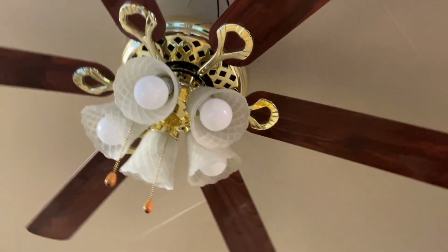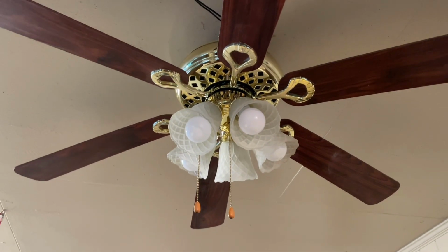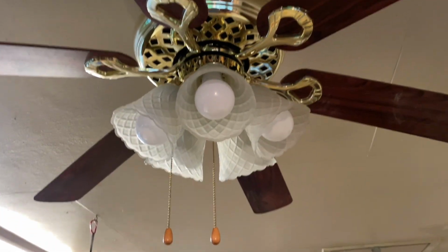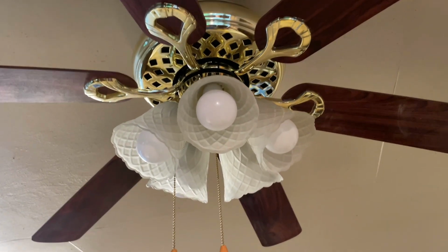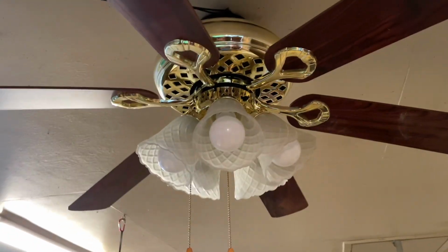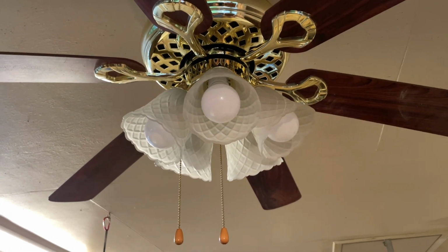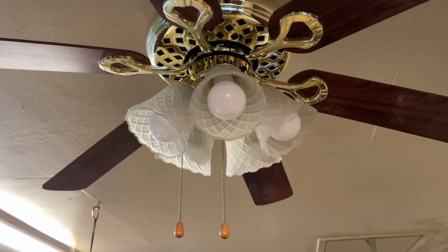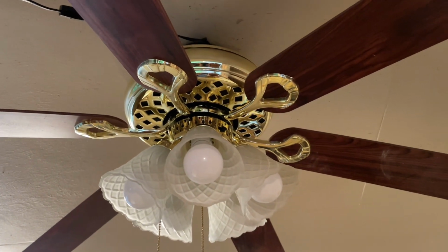The white one, I had it in August and I restored it. That one had a bad capacitor, and I had to replace it and it works great. That fan had very bent blades and I had to bend them back. They're back to shape, and I took it to Habitat, and it was sold quick. It's a really good fan, too. But now I have another one, in polished brass finish.